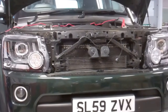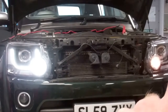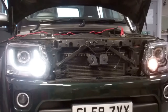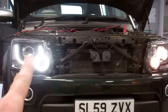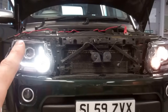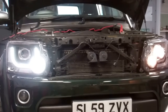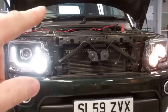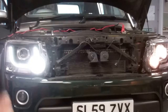Turn the headlights on and see what happens. Notice the signature light — looks much cooler. If you play the video again you'll see this one came on, it realized it was taking too much current and it closed it down. We're going to try putting a circuit in here with a relay, and I think that will work.